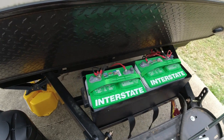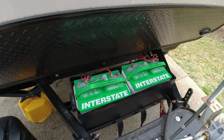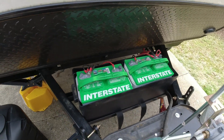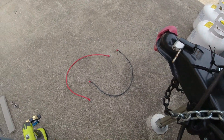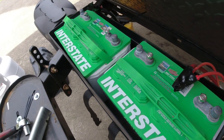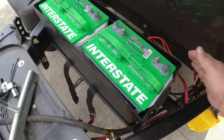First I'll remove the old batteries, being cautious not to let the terminals touch each other. I still have to be careful because there's a wire running in from the solar panel — I could deactivate the solar but I'd rather just be careful not to let any wires hit the frame. The batteries were wired in parallel; I've taken those cables off since I won't need them. I zip-tied the wires, wrapped them with rubberized tape to prevent shorting, and set the batteries aside.